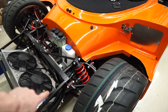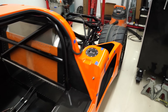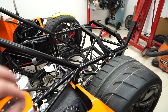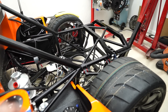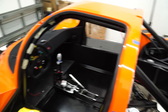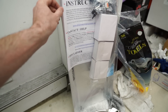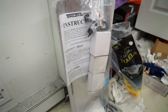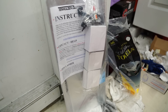I'm also going to be setting the ride height. I already set the rear ride height, which is 160 millimeters measured from the floor to that furthest rear crossbar. I did it with the engine in and set it about four millimeters high because the clam and the transmission still need to sit there, so when it squats it'll be perfect. Then I'm going to do the alignment — I got these plates where you put a tape measure on either side, and they have really good reviews. You can set toe, camber, everything you need for this car. First I need to set the ride height up front.